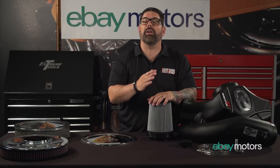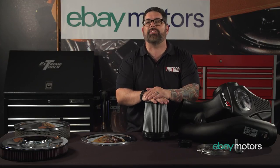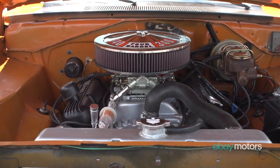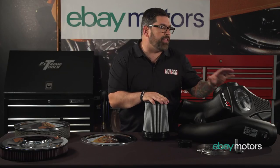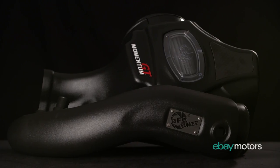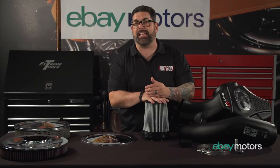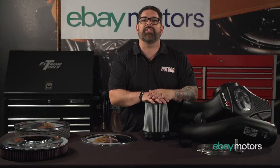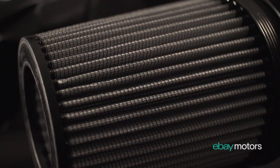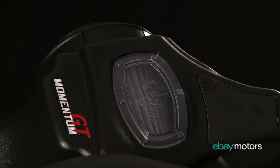Now why do it? Well, to get more cold air into your engine. Your air temperature can be upwards of 150 degrees under the hood, so getting colder, more dense air into your engine can add horsepower and improve miles per gallon. One thing to take into consideration is the application itself. When you do a cold air intake, you have to realize there are other elements — a cam, head package, and certainly an exhaust package — that will make it easier for the engine to breathe and make more power. But that doesn't mean you can't see increases of upwards of 10 to 15 horsepower simply by bolting on a cold air intake or an air intake system.